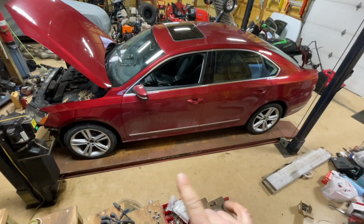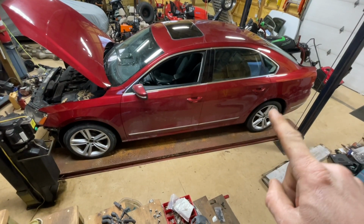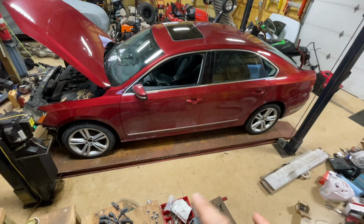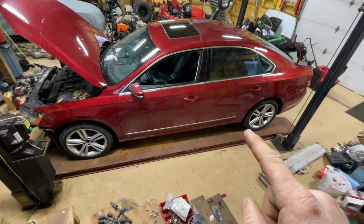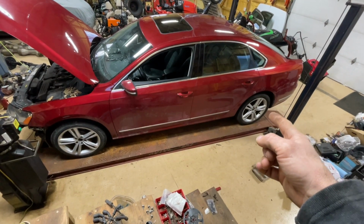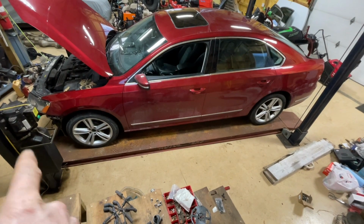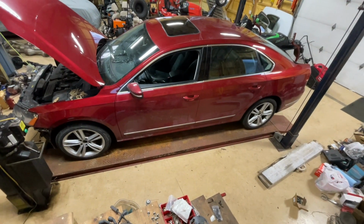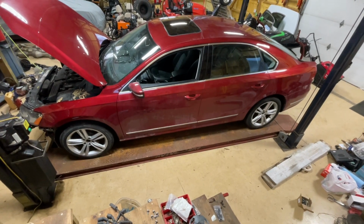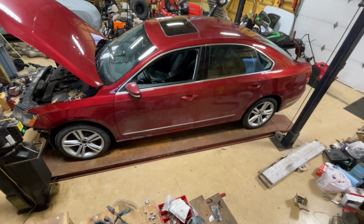But something to keep in mind is that the wheelbase is measured from the center of each wheel. So if this Volkswagen Passat, which of course doesn't, had a 156 inch wheelbase, the center of the wheel would be right at the edge, so it would not fit. You'd need probably 3 more inches. So basically a 153 inch wheelbase might even be pushing it a little bit, but you might even want to plan 6 inches.